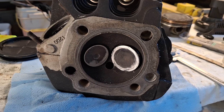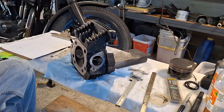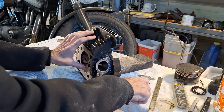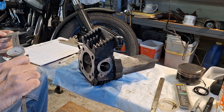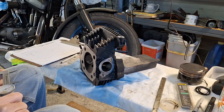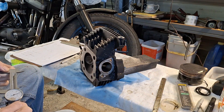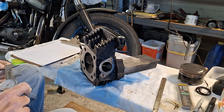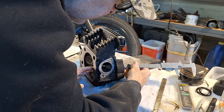Let's go over how you check this without a fixture. First, you need to check your stem protrusion with the valve seated. I put a little grease on these valves to keep them from falling out. I already know these intakes are 2.010 inches, so we take 2.010 and subtract 226 thousandths, giving us 1.784. We set our dial calipers at 1.784 — call it 1.785 — then push the valve down until it opens and stops on the spring pad.